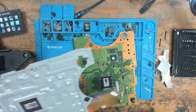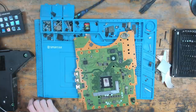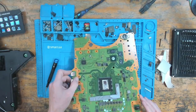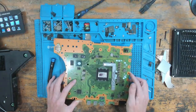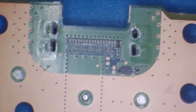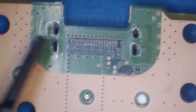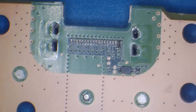We're inside the console now, and there's way too much liquid metal on this console. You can see it's all grouped up in the corner, but we'll sort that out later. Let's take a look at the HDMI port area. Looking at the circuit, we can see that we've got most of the pins intact bar one, and that is pin number 18.